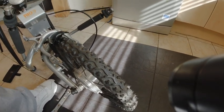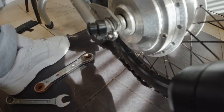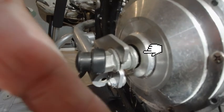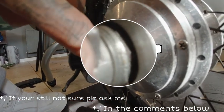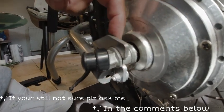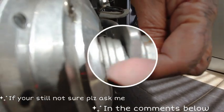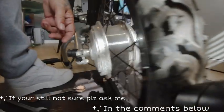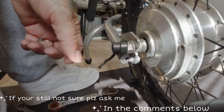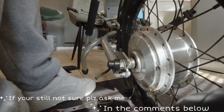Now when you're putting this back on — before you take the tire off, really, you should take a photo of it. I'll put that on the first video. What you'll realise is there are little alignment points here. You have to make sure that when you push in the wheel, these line up. There's one on this side and one on that side, and they have to line up with each other. You've only got the nut on this side. All the washers and everything are on here. This has to fit in here, same with the other side, and then you should be good to go.